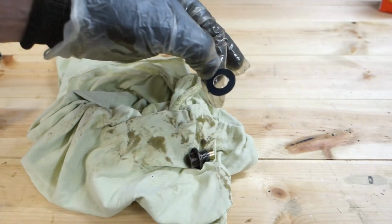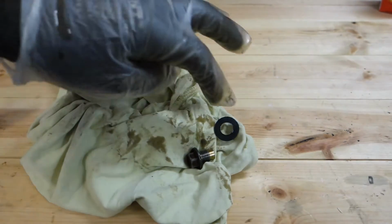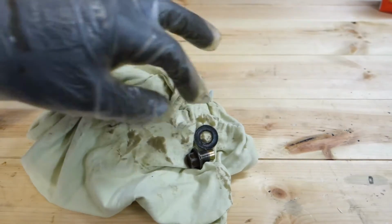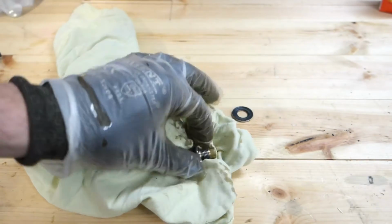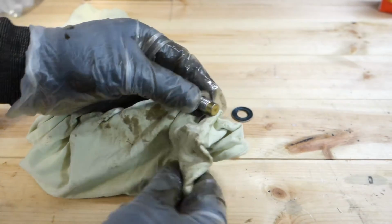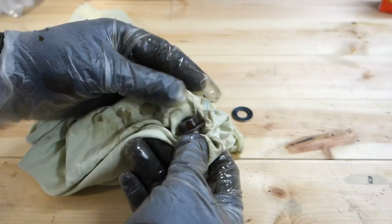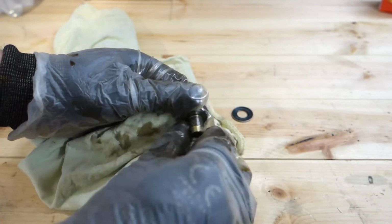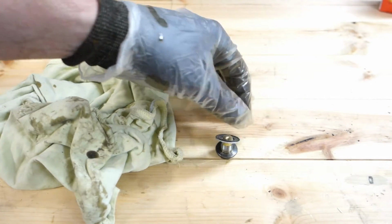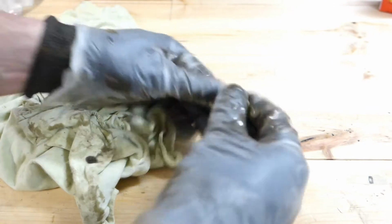And we can find these best quality parts in the nearest Toyota dealership, and that costs about $1 to $2, or euros, per piece. And then it's good to also clean that bolt and check that there are no metallic particles. If you find any metallic particles in here, then you might have an issue in your engine, because metal is always bad with oil.